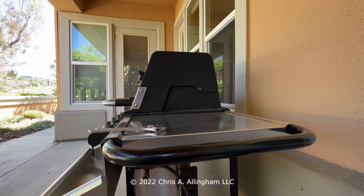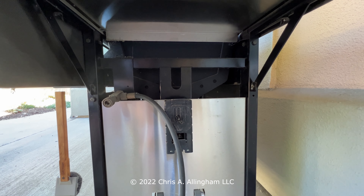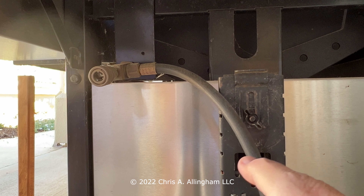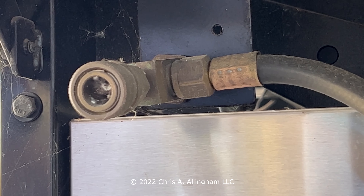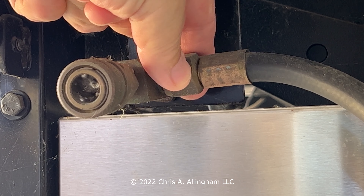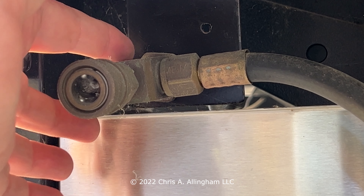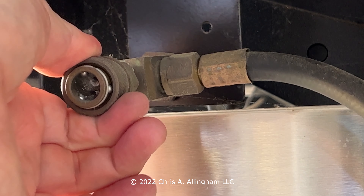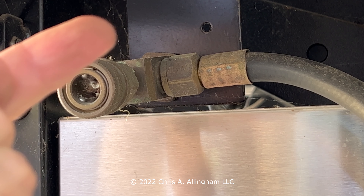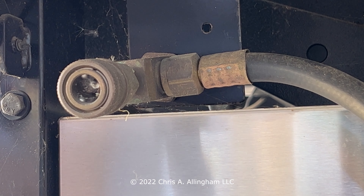Just to give you some reference, here's the right side of the grill. Underneath the work table, this is where the propane tank connects and hangs. You can see the connection I'm working on — this is the regulator hose right here. Zooming in closer, here's the gas line coming in from the hose. It connects right here. This is the nut that I'll be loosening and it goes into this block that goes inside the grill to the manifold. Out here is a quick disconnect, which I imagine was an option for a side burner mounted above. So all I need to do is loosen this nut to get this hose off.